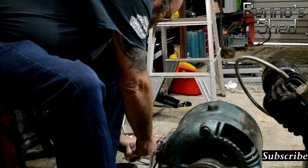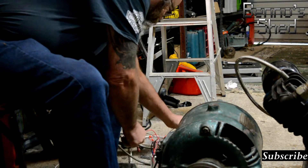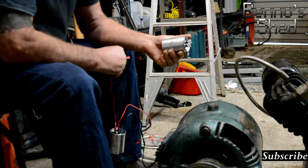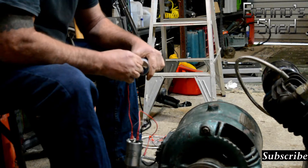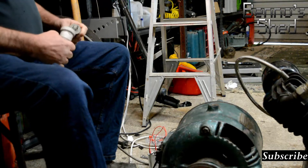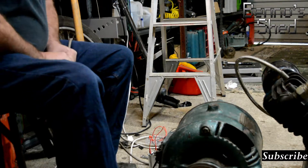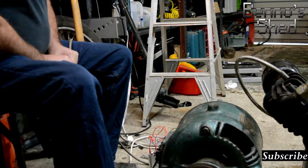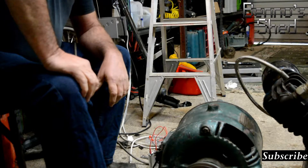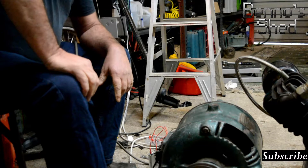It's running a little bit quicker but definitely not running like it should. Let's try an extra 10 microfarads — so that's a 30 microfarad capacitor. Plug it in. We'll just keep adding capacitance until the thing will start. Bingo! So 60 microfarads will start and run this thing.